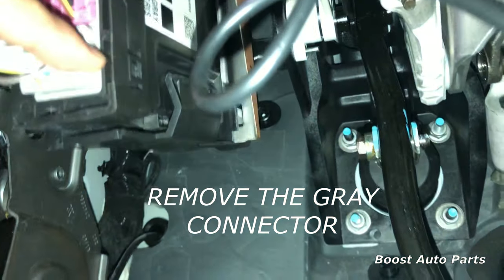Slide the brown connector back in — you should hear and feel it clip. Take your taps and tuck them all back behind this area. You can use a few zip ties to keep things up out of the way. For the ground, make sure you ground out in the cab. You can ground anywhere in the cab using whatever method you'd like. Here we've used a ring terminal available at any hardware store, running both black wires to it. If you don't have anywhere else to ground, you can use this location — it's just a good metal surface.